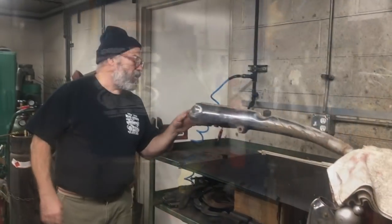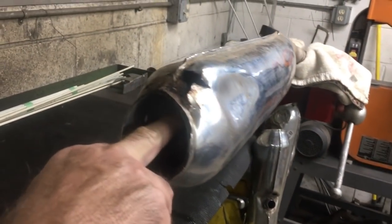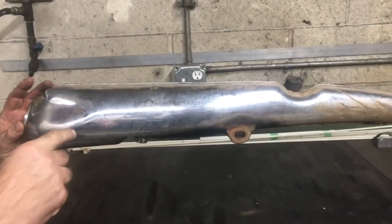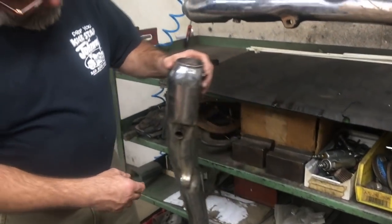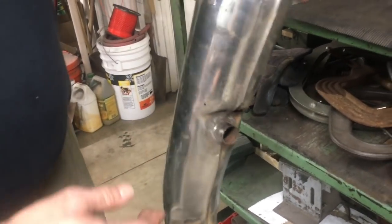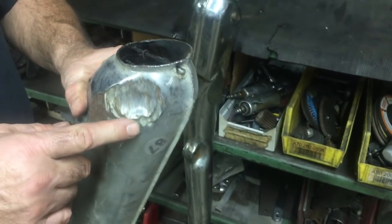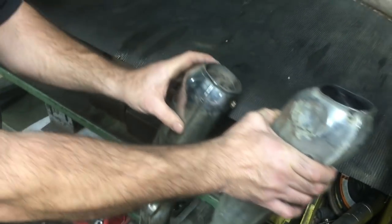If you come to this side, you'll see the baffles. Because they're so old, the baffles are rusted in there — they're stuck. So what we're going to do is not throw these pipes away, but we're going to cut the pipes right here because this one is damaged. We need three baffles and we've got three pipes — this is why I kept so much stuff over the years. This pipe here is kind of crushed and bent. So we're going to cut the pipe out, take the baffles out of the damaged pipes, and keep it all genuine.